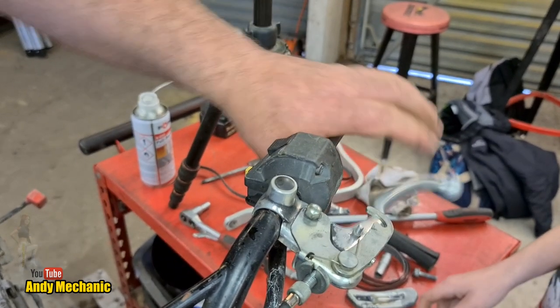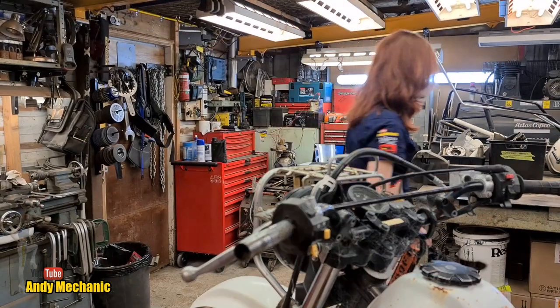Done - sort of. We need a new cable and a new lever. Other than that, it's like a new one. Well, there you go crew - super short video. It's not a difficult job, but I'm pleased we've done it while Holly's been here, because we've highlighted we need some more parts. We need a new clutch lever because it's worn and that's causing it to flop around, and for that automatic little lever system to hold the clutch disengaged it isn't going to work - it's not going to be reliable and it could cause an accident. There's a lot of drag on that clutch cable too - I could probably fill it with some three-in-one oil, but they tend to go pretty quickly after that, so I'll just buy a new one and it's good for years to come. We need to make it as light as we can on the clutch, because Holly's only got little tiny hands.